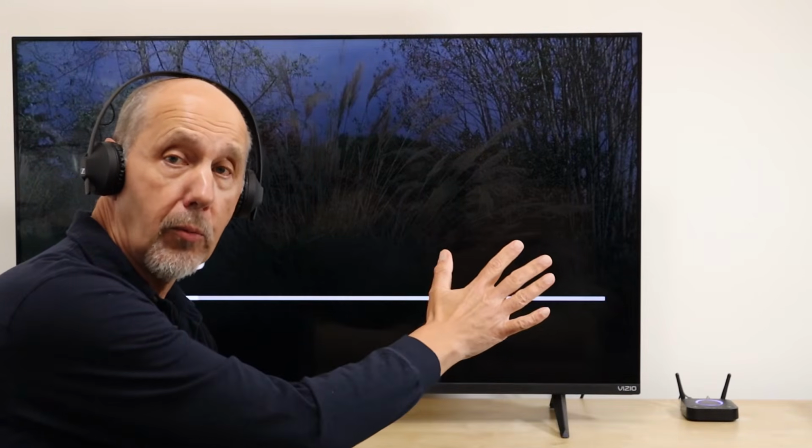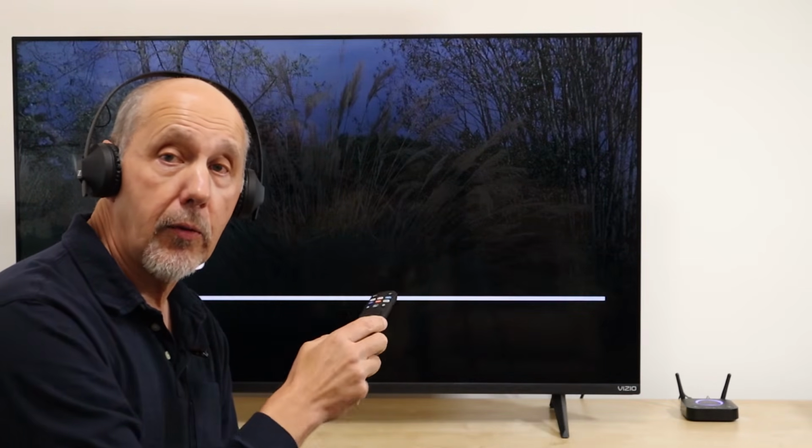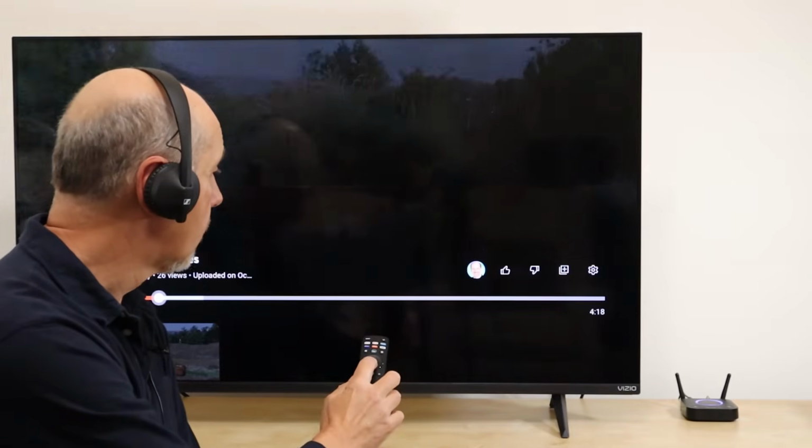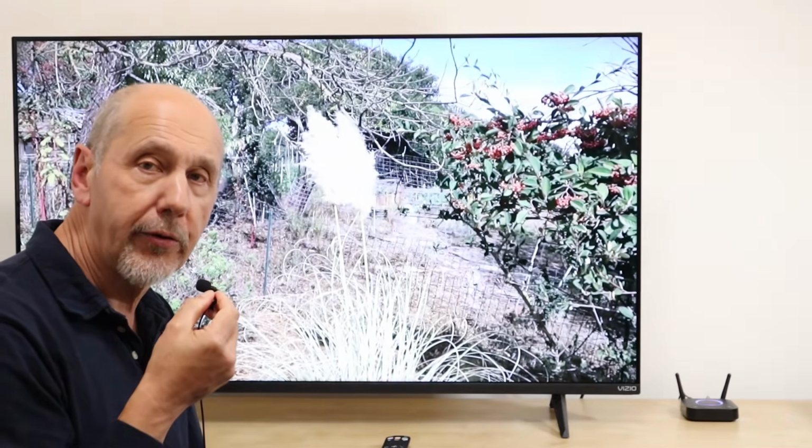If you want to use a Bluetooth headset for watching TV, you're going to want to mute the speakers that you use for normal TV watching. You do that using the exact same volume control that you always use. It doesn't affect the headset because the volume on the headset is controlled on the earpiece itself. I'm going to demonstrate this by starting a video. I'll mute the external speakers, and then I'll demonstrate that the music is still playing through the headset. Audio muted. And the music is still playing through the headset.